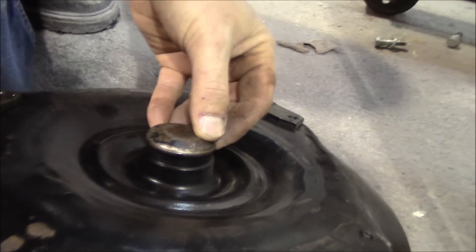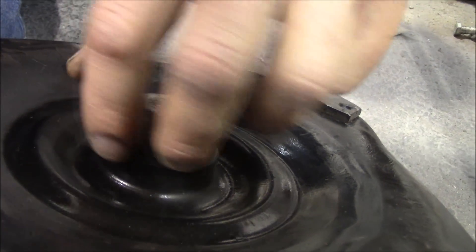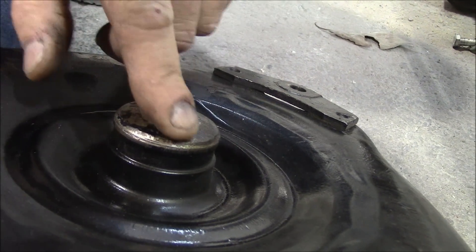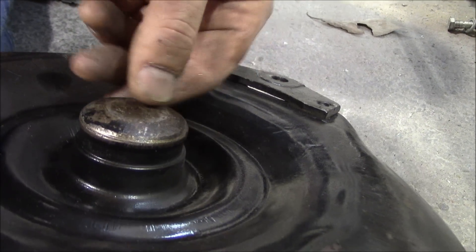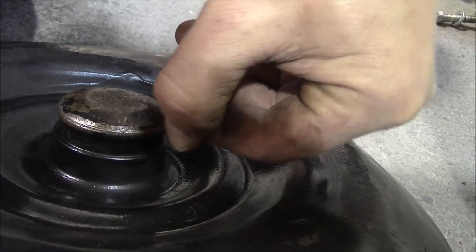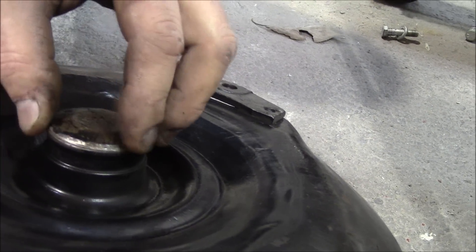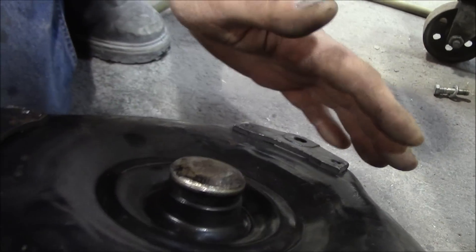Now as you can tell it's not very clean. I'm always very careful with this kind of stuff - I don't want any paint on here. See how the rust is? You can't even see this unless you're here, but it's got rough edges around here. This should be completely cleaned up in my opinion when you put it in the car - no paint, no nothing, nice and clean smooth. You can do that with a piece of emery cloth.